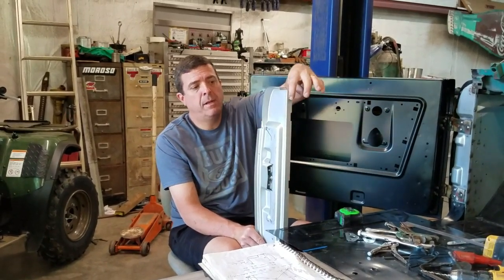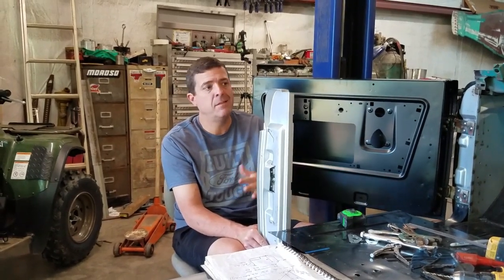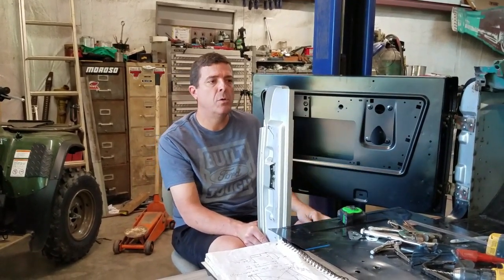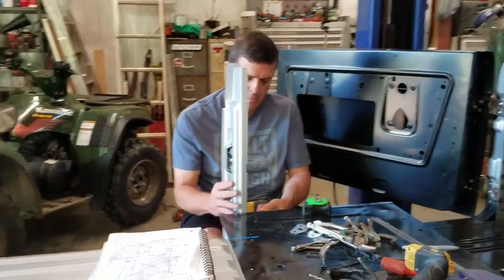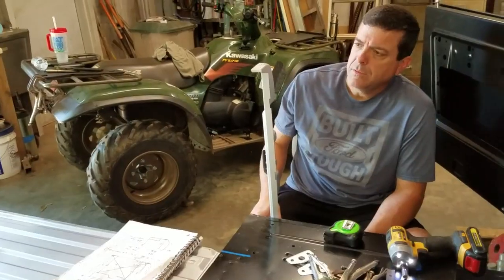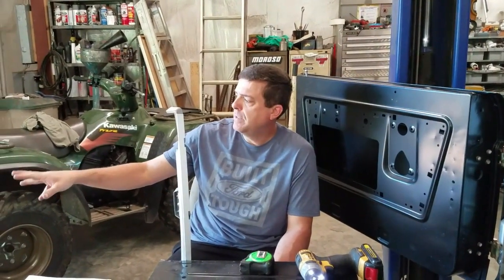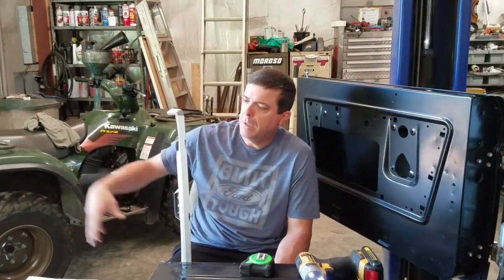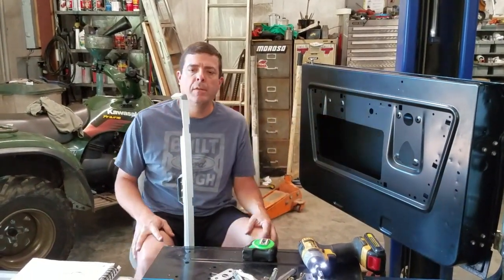You start with this, put it at 18 and a half inches, go ahead and put a couple screws in it so it holds it in place, and then you'll start closing your door, start seeing where everything hits. So I'll stop there, just get this one close, and then we'll go back and we'll set the rear post in, so we have something to set the quarter panel on. The upper quarter, because these things are in two pieces.